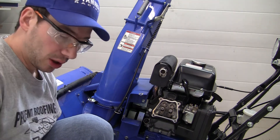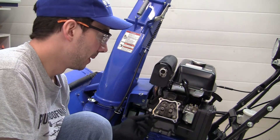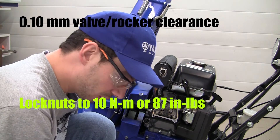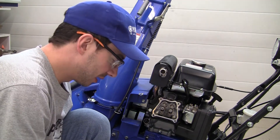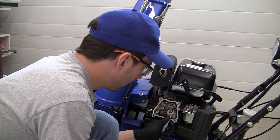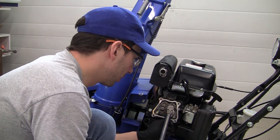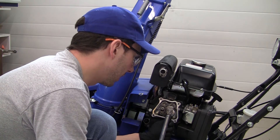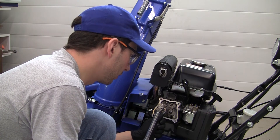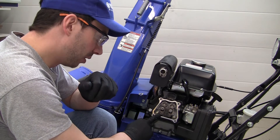It took a little bit of playing with it to get the feel on how to adjust it, but now it's adjusted and torqued down to 0.1mm. What I'm going to do, since we're in here as well, is confirm that the torque on the intake lock nut is set correctly — I'm going to try really hard not to move it for obvious reasons. So that's good. This is the one we adjusted — it's good. So I've got this adjusted to 0.1mm and this one is where it was before at 0.11.